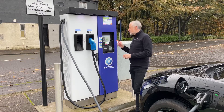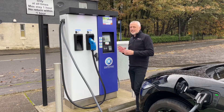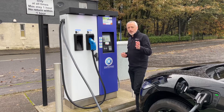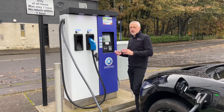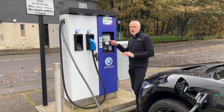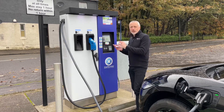I'm on quite a high state of charge here — 78% — so probably when I get to 80% it will start to really slow down. I've done a video on charging on AC and DC, what it all means and the charging curve. Here it's starting off at around 23 kilowatts; I might get up to 50 if I'm lucky, but it will probably be quite slow after that.